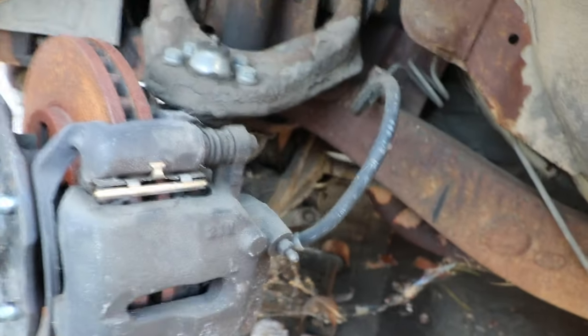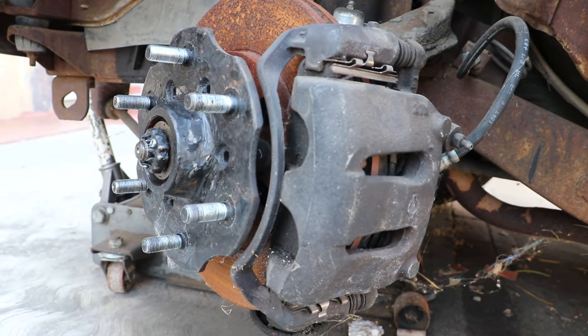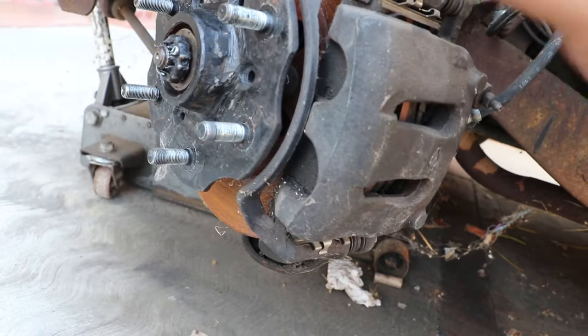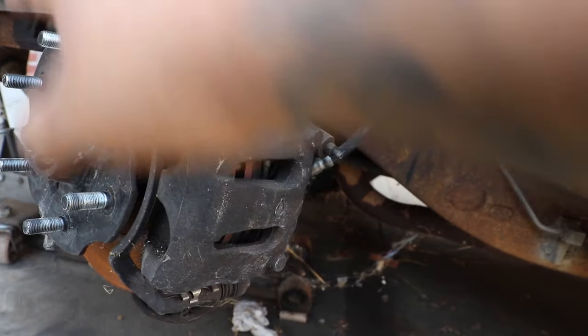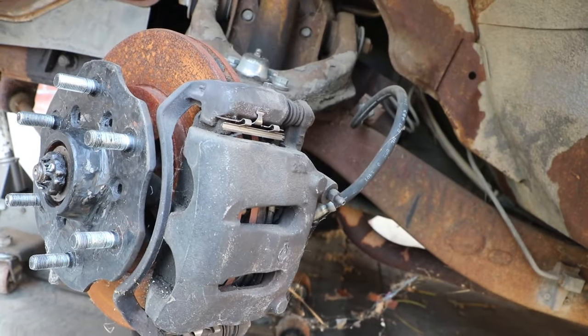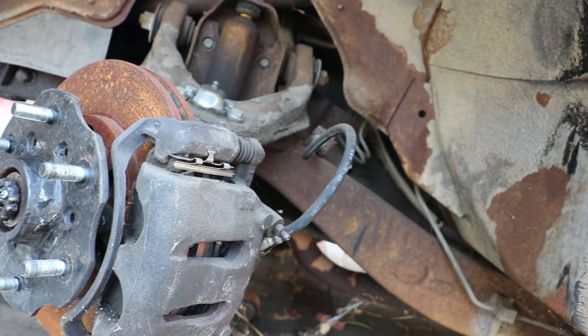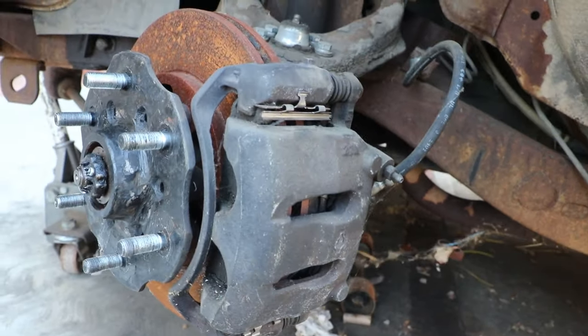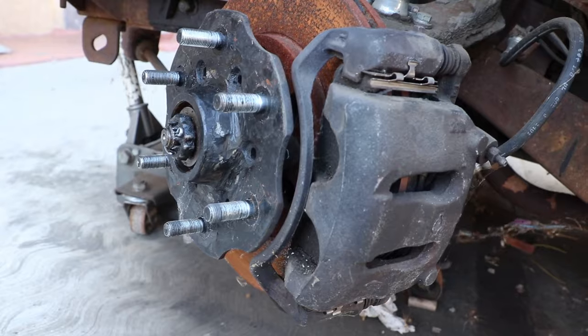So that's what I got going here for some of you guys that were asking me on Instagram. I'm happy to do it. So, '92 hard body rotor, bracket, caliper, brake pads, hub, and spindle, if you already have the drop spindle and ball joint conversion. If you already have that, this is simple. Get the stuff at the junkyard and buy new brakes. Done. Buy new bearings, pack them, put them in. Easy.